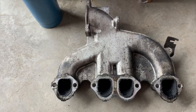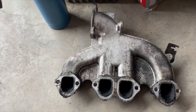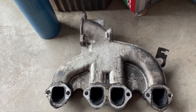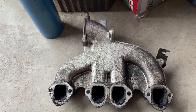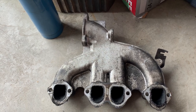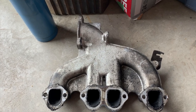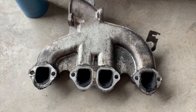I'm replacing the intake manifold with the BRM intake manifold. I know a lot of guys like the PD-150, but BRM is more readily available, and somebody has done some flow testing and actually found that the BRM intake manifold flows better. I'll try and post a link in the description if anybody wants to see the results of the flow test. Of course, I need to clean this intake before I install it — it's pretty gummed up inside.